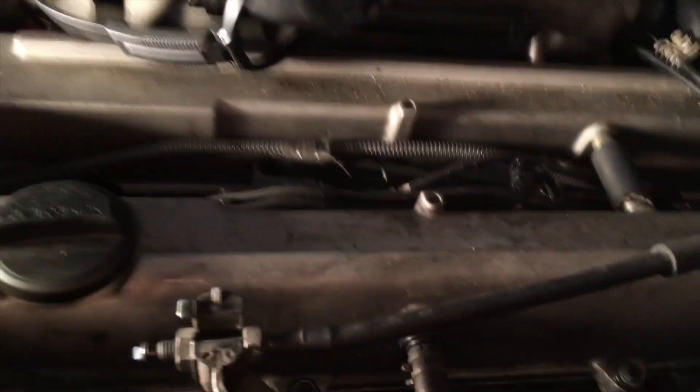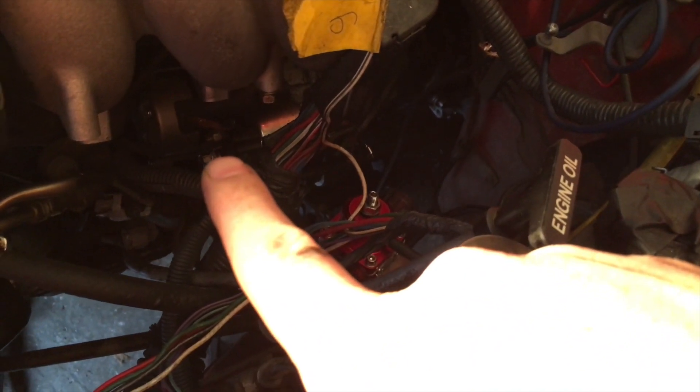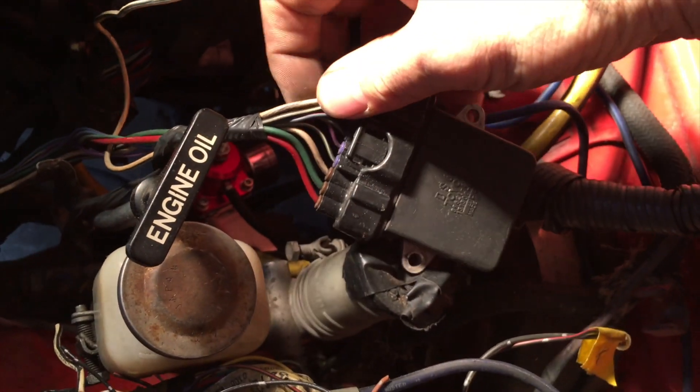To conclude: you need power to the coils, power to the injectors, hook up your starter right there, and hook up your ECU. I just did battery and plus B. This white one goes from here to here — that one's just the ground. I think that's all you need. I made this video because everything I tried to find online wasn't there.